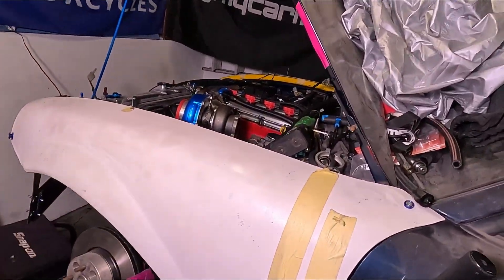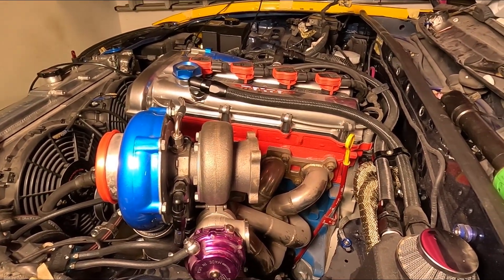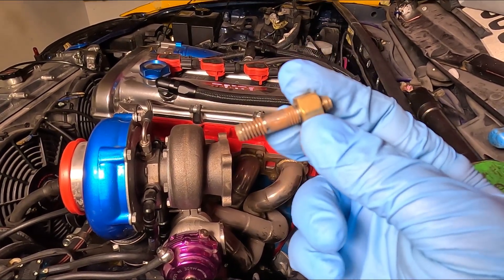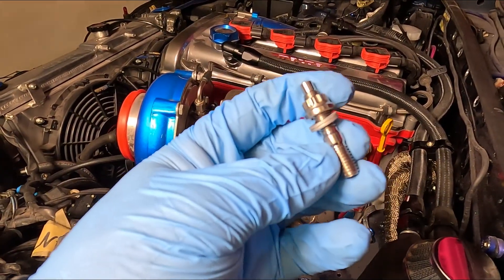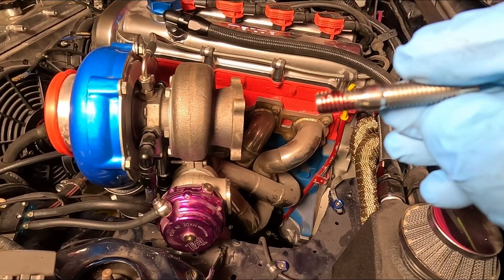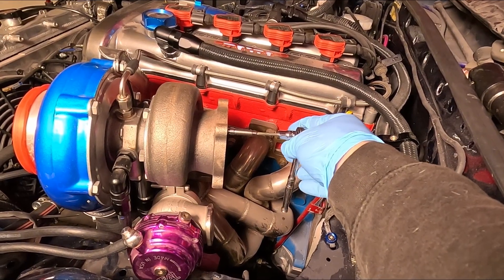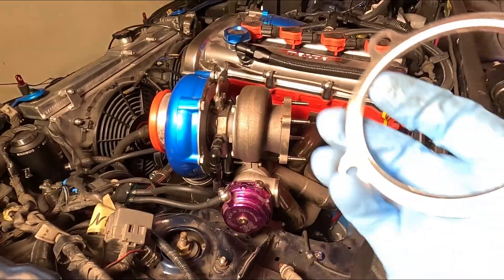But before I put that back into the engine bay there's something else I want to address. While assembling this engine and planning the downpipe I was using some mild steel studs with brass nuts, and I'm pretty sure at some point these will fail — I've seen many builds with the downpipe backing off. So I'm going to upgrade to some titanium studs with bihex nuts and a Nordlock washer. I'll put a little bit of high temperature retaining compound on the thread and screw that into the turbo. These titanium studs have got an allen key in the end so I can snug them down. All the studs are snugged down — it's time for the gasket.